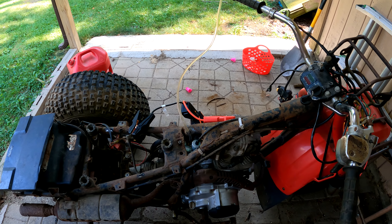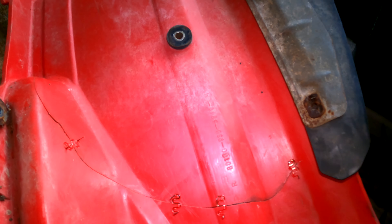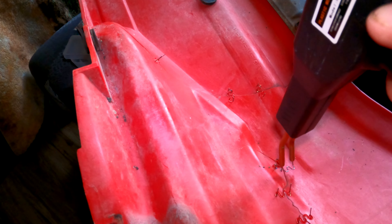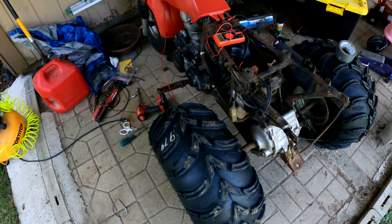No smoke at all — that's awesome! Let's try to button this up a little bit and make it look nice. I was looking at one of the fenders and it is cracked — there's a big crack here and a big crack here. I've been using this plastic welding gun: you put a piece of metal in, pull the trigger, it heats up, you press it in, release the trigger, and pull it up. I'll clean up these cracks and see how well it holds — it's been working pretty good so far.